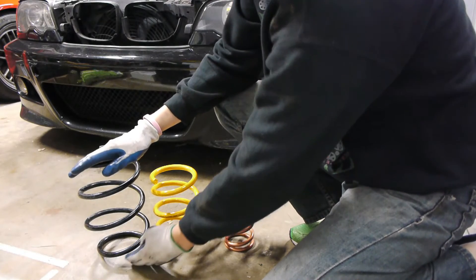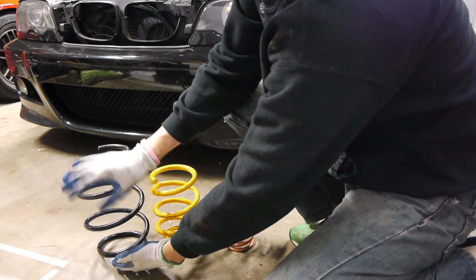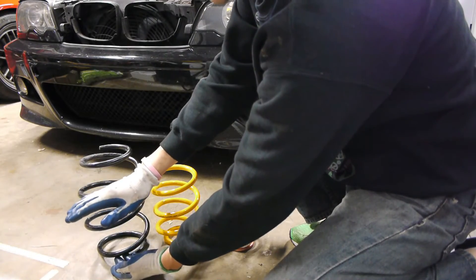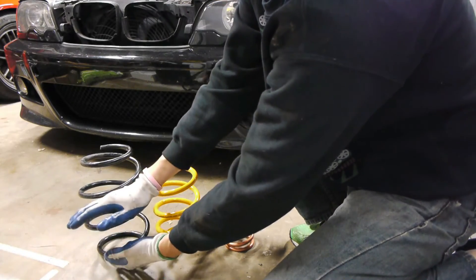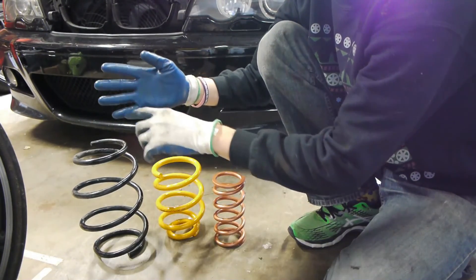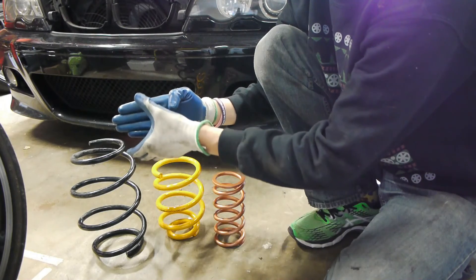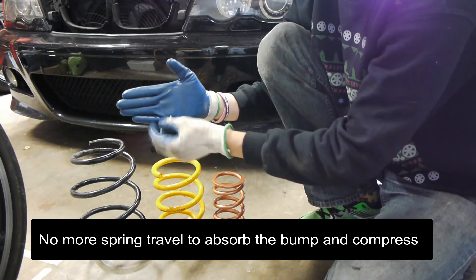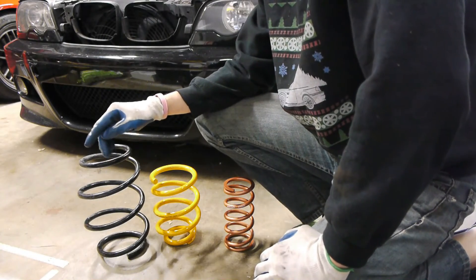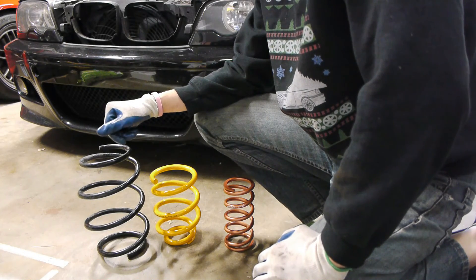The bump or compression component is what's left over from the car sitting at equilibrium. At current ride height, the spring is compressed about five inches, and before the coils bind — pretend your fingers are the coils — you compress the spring until each coil is sitting right next to each other. At that point you won't get any more compression; the coils are bound and it's as if you have no spring left. There's a very important component still missing, which is the shock or strut itself, and I'll talk about that in the next video.